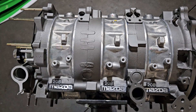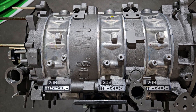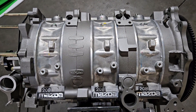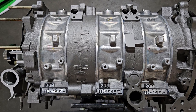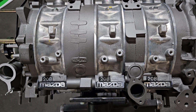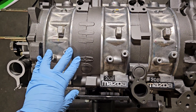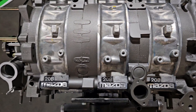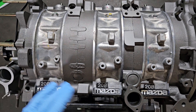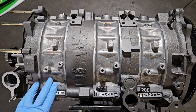Since this motor came in for a complete stock overhaul and it was in good condition, we were able to bring it back to almost 100% original condition. We did not have to lap the side housings — it was low miles. All the bearings got replaced with OEM bearings. All of the side seals, springs, corner seals, and apex seals were specified as OEM components. When you're building an OEM car in a stock configuration, all of the components that Mazda used and produced are fantastic — they have some of the highest mileage potential, especially when you're talking about apex seals. There was no reason to go to aftermarket seals because the goal here is simply reliability, longevity, and OEM performance.